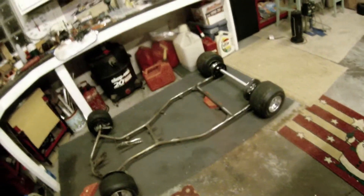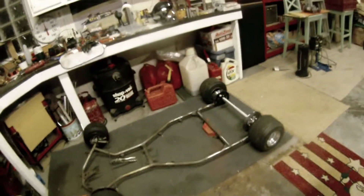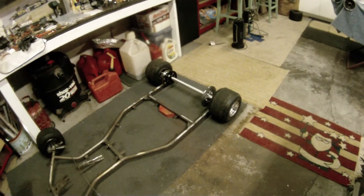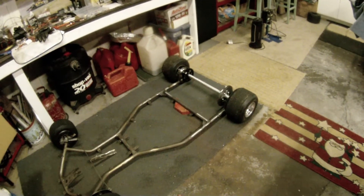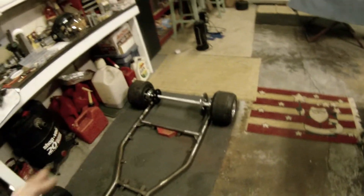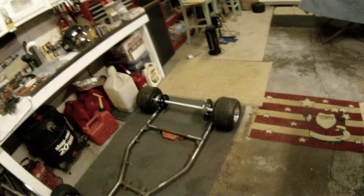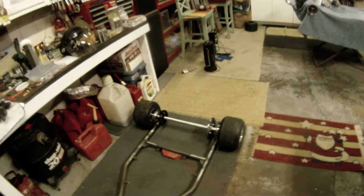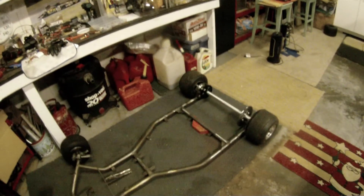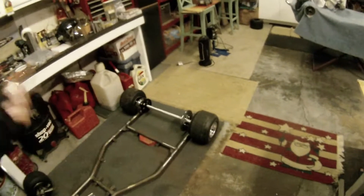So there's your mock-up. We can go ahead and weld. We get this thing back up in the air tomorrow and can go ahead and get the rear squared up, measure everything, get it crisscross front to back, square it up, tack-tack, make sure they stay square. All those are self-aligning bearing cassettes — we want to get it as straight up and down as we can, but we don't have to remove any material.